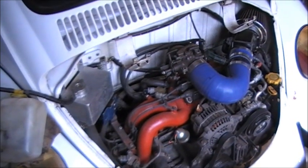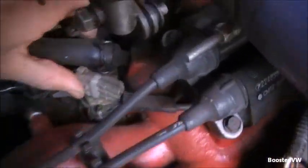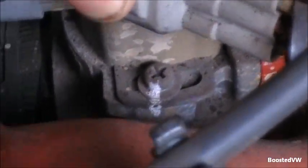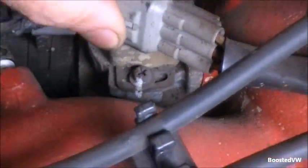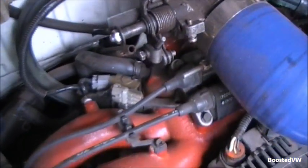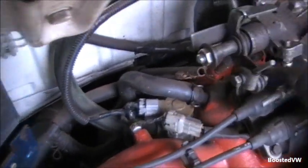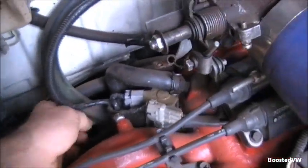This is a 1992 manifold and as you can see it still has the factory sealing paint on it — the idle valve has never been apart on it, so quite amazing that it still functions as well as it does. For the quick cleanup, all that involves is pulling the intake hose off it — this thing here — and then pumping it full of the trusty Subaru upper engine cleaner.